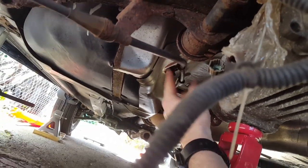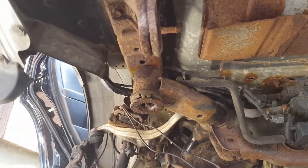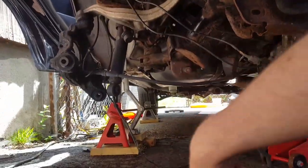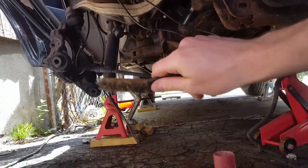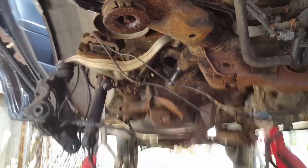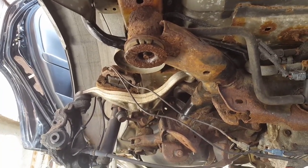There are actually two brake line bolts, one for each brake line. I let the penetrating fluid sit for a while. I'm going to be extra careful removing these — I'm going to scrape them off with a combination of a hand wire brush and a larger brush, then spray again, and then use some heat before I even attempt it. I'm so close to getting this thing off that I want to do it the proper way. It's all about the prep.